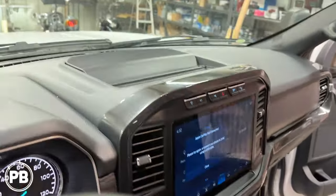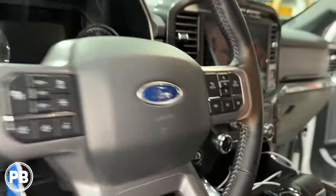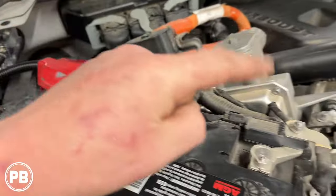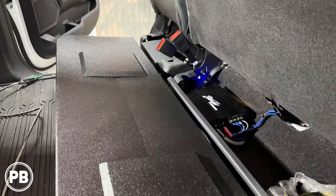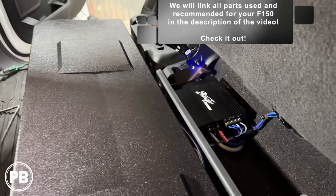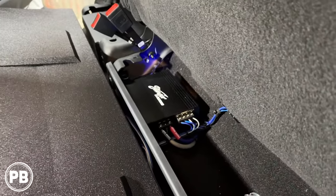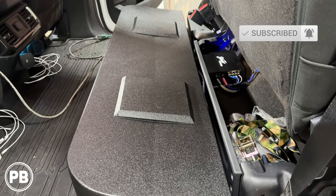The radio is all reassembled — looks nice and clean. The bass knob is mounted flush, easy and accessible but out of the way. With everything connected at the amplifier, we connected the positive on the battery. If you're concerned about sparks, remove the negative first, connect your positive wire, then put the negative back on. This install went in great — sounds awesome, tons of bass. We set our gains using the SMD DD-1 to the factory radio, everything is tuned. We'll link these parts along with different variations in the description. Super satisfied with the outcome — hit the like button and subscribe!